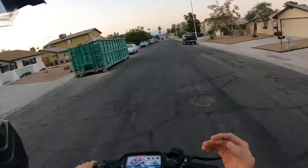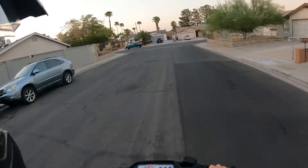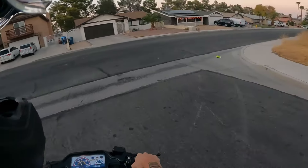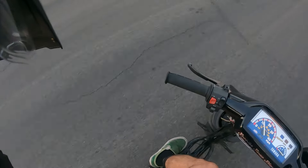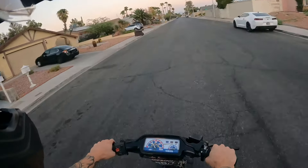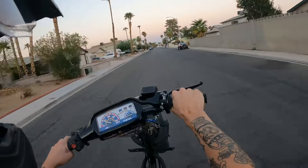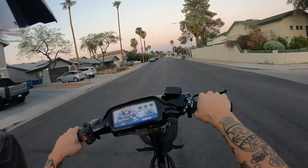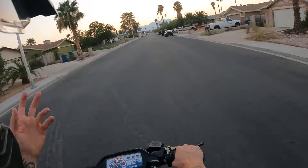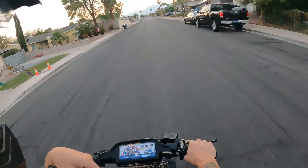I don't want to be too hard on it — it still is the first real run on this engine, so we got to be somewhat gentle. I've never rode a Zuma in such skeleton mode like this. The tune is on right now. The carb tune is feeling really perfect. I think it's got about all five-gram fives in it right now — rollers. Last setup I ran on this cylinder on that other bike we built, I ended up with four grams, 4.5s and fives. Someone's going to be very happy with this engine. We got to be a little gentle — if it's going to break, I'd rather it break on me right now than send it to someone. Whoever gets this, I want to be able to slap it in the bike and rip it. We'll do a couple more laps and then we're going to do some wheelies on it, but let me break this in a little bit more.